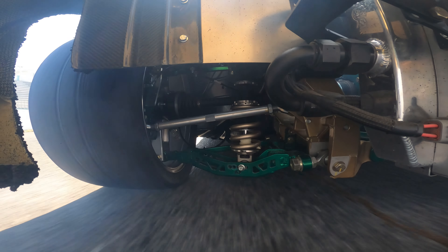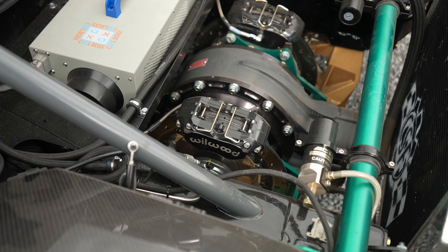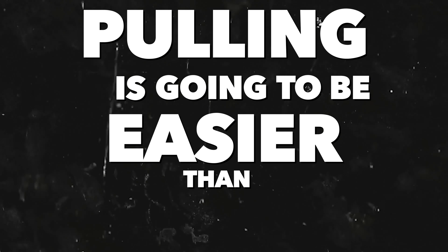One more important downside: in the event of breaking an axle, yes, you would lose brakes on that wheel. But in drifting, as soon as you break an axle you are absolutely done regardless — a broken axle is actually more dangerous than most things because it drives the car completely straight. Traction on the tire that can no longer be driven is going to cause you to straighten heavily or go straight into a wall.